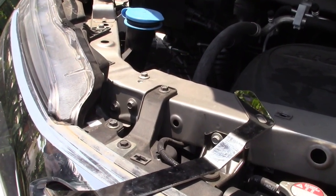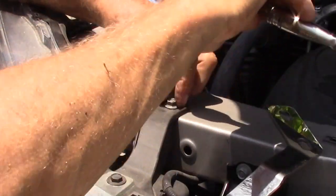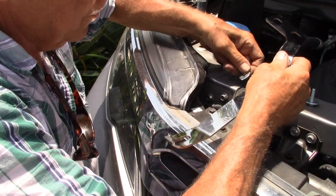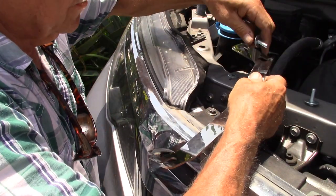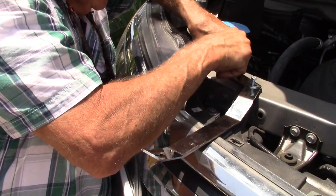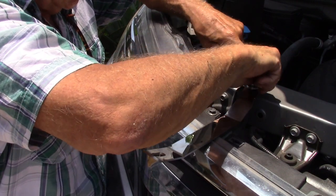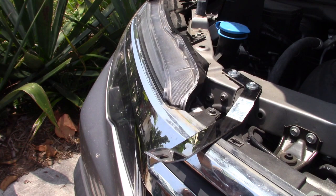We're under the hood and this is the passenger side. These two bolts are removed. These longer screws replace those short ones. We need to place spacers — there's a washer that goes over each of these holes and then these go down through. We want to take these down and just snug them up. They'll have to be positioned when the grill guard goes up. We do the same to the other side now.